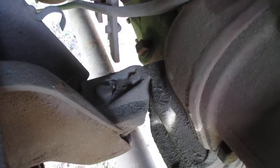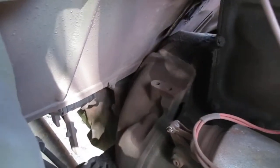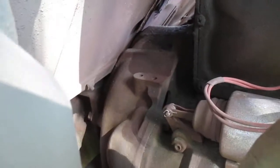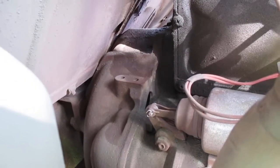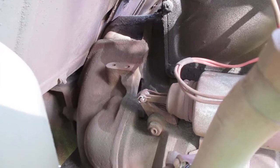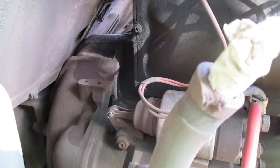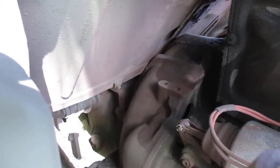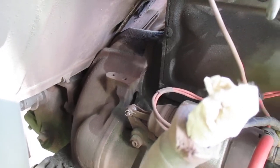The transmission I have in here is also from the CCKW and it's a five-speed. There were two manufacturers that made them: one was Clark, with their transmission called the 204VO, and the other was Warner Gear Division, whose transmission was named the AST-93. The World War II bell housing will bolt directly to a GM 270 within the date range of 1940 to 1958, and the five-speed transmission will bolt directly to the back of the WWII Chevy bell housing. It's a good match — the input shaft lines up with the clutch; it's a 10-spline input shaft.